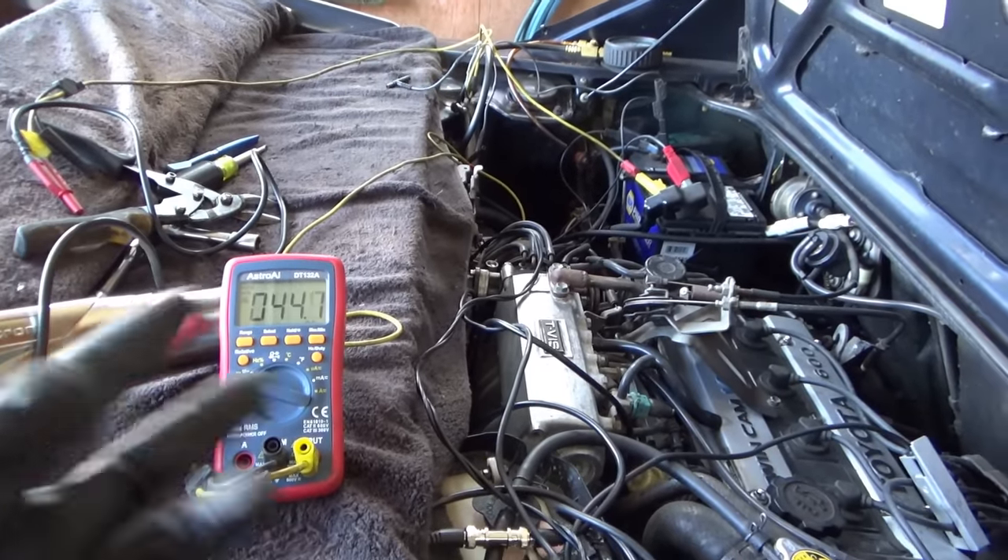So what's the deal? Why is this thing lean at idle? Oxygen sensor never goes rich at idle. So it's either the vane airflow sensor is under-reporting at idle, or we still have a vacuum leak somewhere. We can smoke test the intake and see. If it runs fine otherwise, the vane airflow meter is doing what it should. We can look up some service info to see if they give us voltages - I doubt they would but we can try.